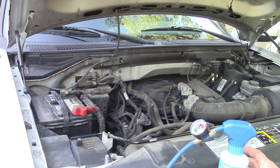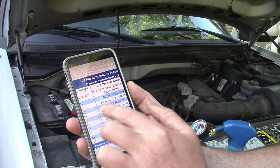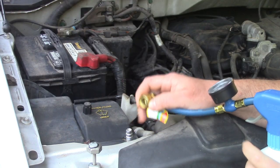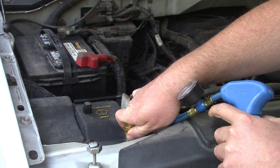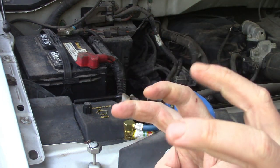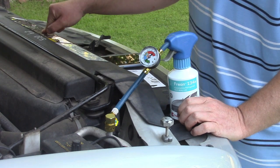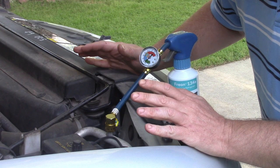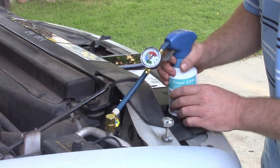These gauges read low side pressure. High side pressure is the important one but we don't have that capability today. If you look at a chart for low side pressure, on a 70 degree day we should be somewhere between 35 and 40 PSI on the low pressure side when the pump is running at max AC. As I hook this up to the low side I'm going to give a little squeeze to purge some of the air out of the line — wasting a little gas won't waste much quantity. This can contains 12 ounces of refrigerant and the sticker on the front of the engine says I need 33 ounces, so we're going to go through about two and a half cans.